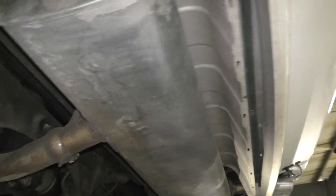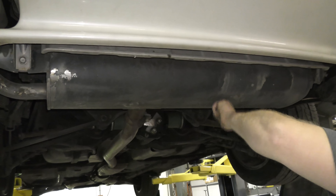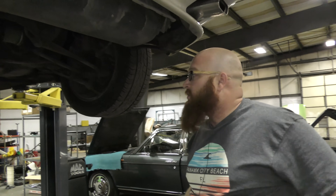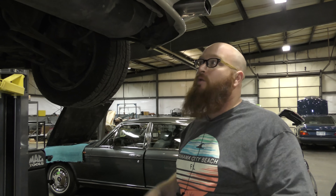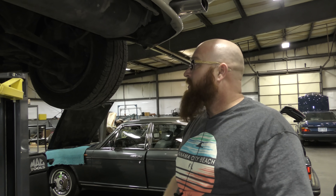There's a nice big muffler with dual exhaust. I didn't notice looseness at the wheel bearings other than that front tie rod end. I'll road test this to determine if there's actually a wheel bearing noise. Let's go ahead and lower this thing down.